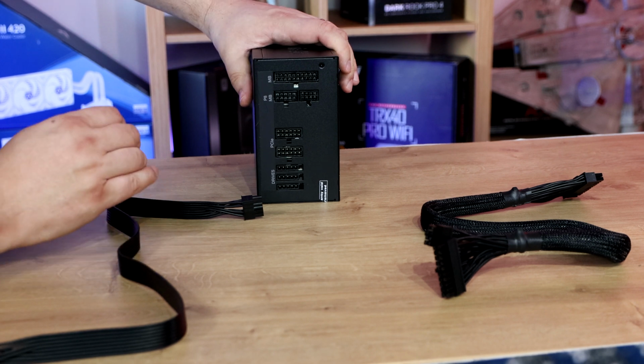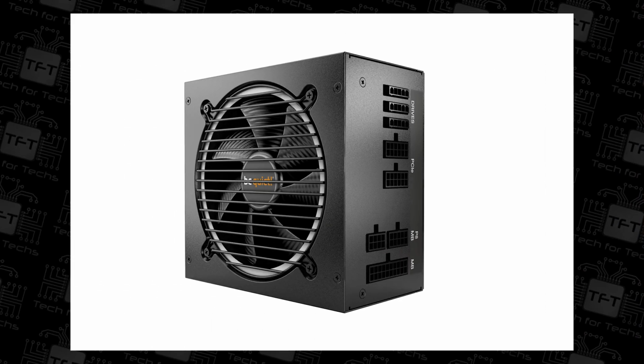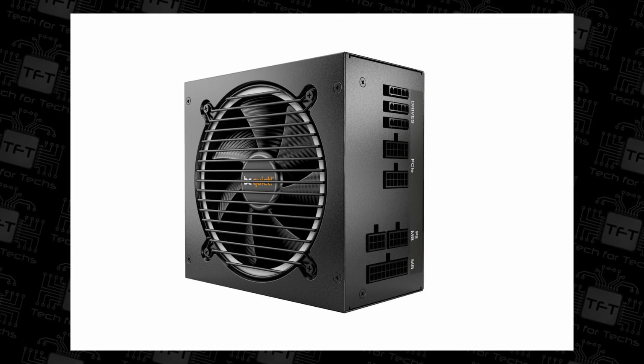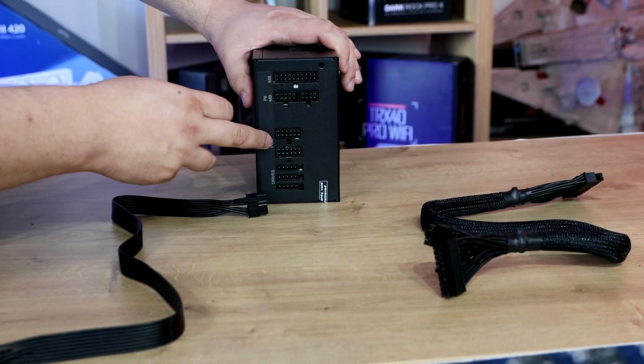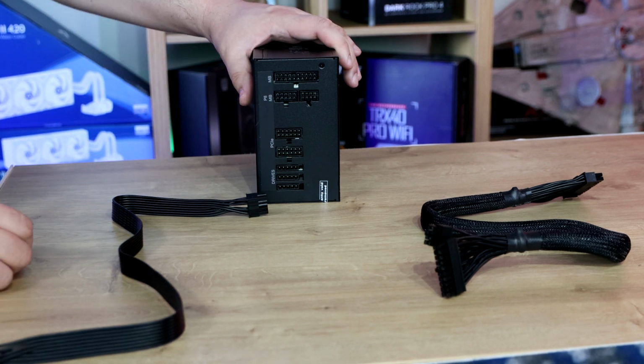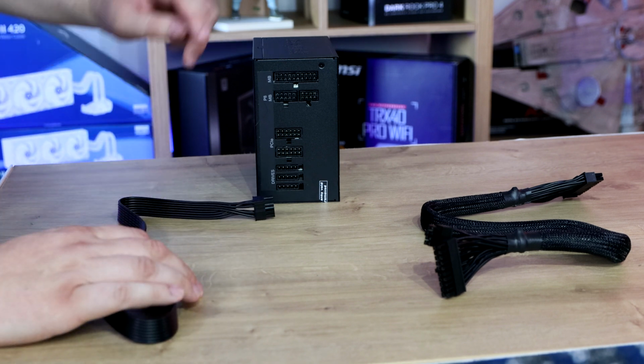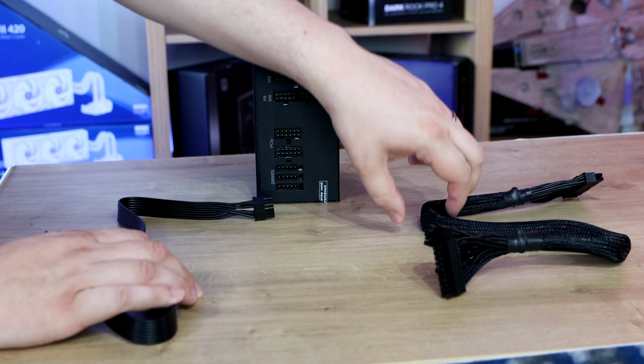You look at the back of the power supply and it tells you exactly what goes where. So drives is, for example, the SATA and Molex connections. PCIe is, believe it or not, for the PCIe cables. You've got P8 motherboard, that means the 8-pin motherboard, which is also known as the CPU cable. That's where that plugs in. And then motherboard, which is your 24 pin.